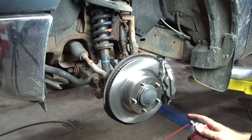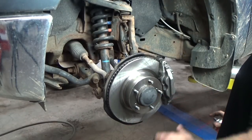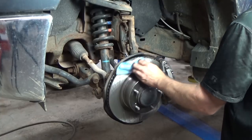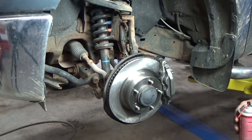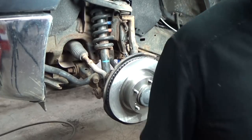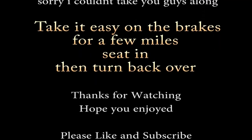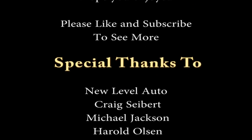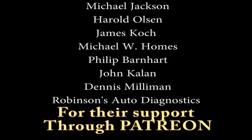Okay, if you think you have any grease on the rotor, just take and spray it down with some spray cleaner. You don't want to go spraying the pads because you're going to take up all the grease you put on them. It'll evaporate off soon enough. Now I'm going to take and reinstall the wheels, and we'll take it for a test drive.